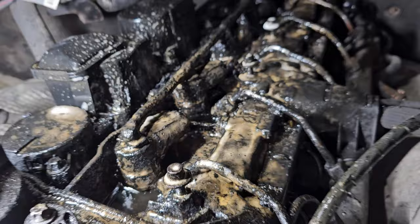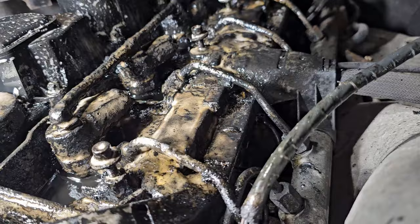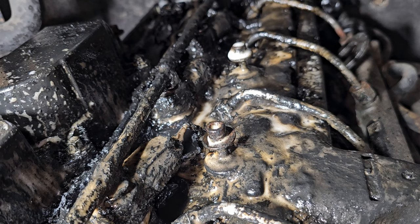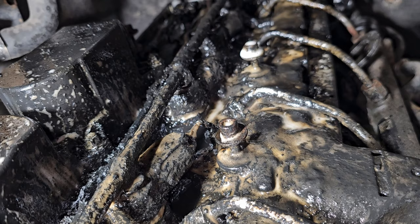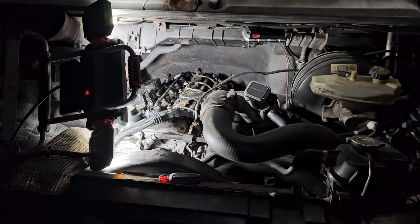It's about 9:30 at night. I don't think I'm going to sleep tonight. At minimum, I want to try to get injector 3 out, if it's even possible without the right puller, and change the seal under it, get it buttoned back up. But I'm going to do as much cleaning as I can until I collapse, I guess, first. And try to get it done.